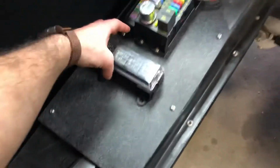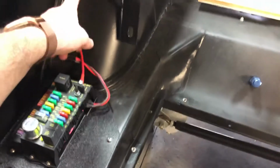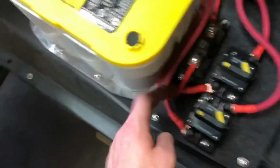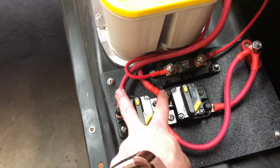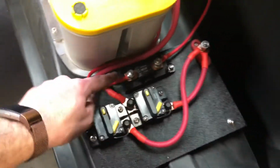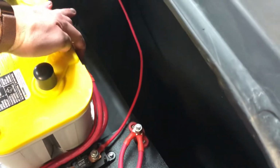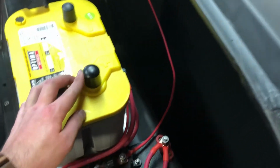Got this relay box, got a wire in still. I went ahead and ran this crossover. I'm still gonna put some nylon braid over that. It comes around, it runs across underneath this deck, comes out over here, and around to this mega fuse. The mega fuse I have just kinda, sorry about the camera work, looping around to the stud. So I have my 2 wires coming off the breaker going to the stud, and then the one from the mega fuse going to the stud. I could have ran from this just to over one of these studs maybe, but I needed to eat up some space on this bolt anyways, or use a washer because the bolt was bottoming out.